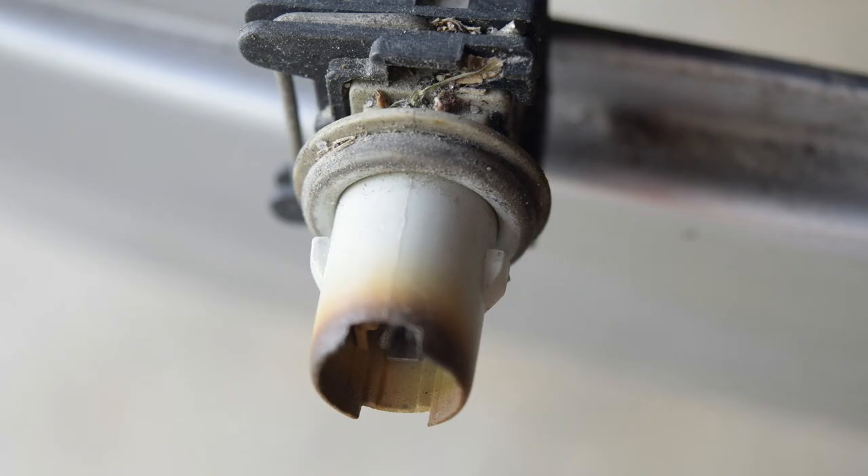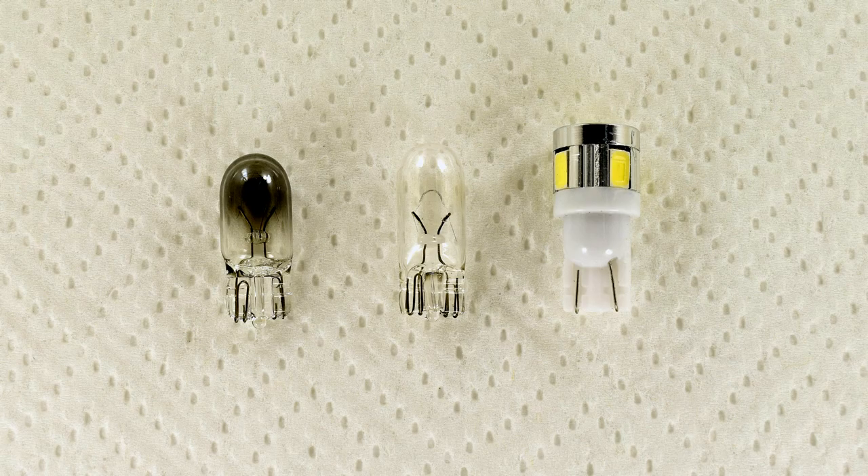In this picture, the bulb has been removed and the damage to the bulb holder can be more clearly seen. On the left is the bulb I removed, in the middle is a new bulb that would normally replace it, but instead I'm going to use the LED on the right. If you have the side lights on when you remove the original bulb, you'll find it's very hot, so use a cloth to prevent burning your fingers. It is a good idea to have the side lights on because when you insert the LED it may not work — but don't be alarmed. The LED is polarity sensitive; just remove it, turn it around, and it should work properly.